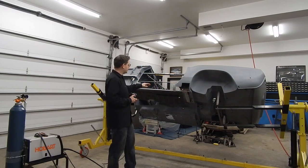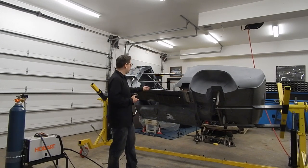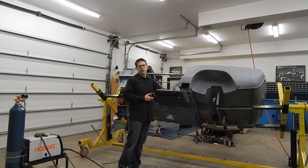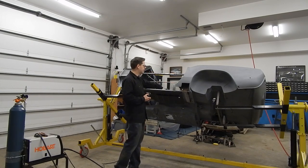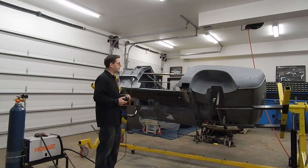What I've found is I can actually start building out our inner sill and our outer inner rocker panel, outer rocker panel, and still have plenty of access to come in here, grind welds, and clean things up. With the rotisserie I can get to the backside very easily, so not a problem there.